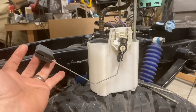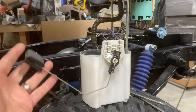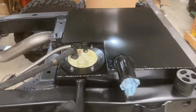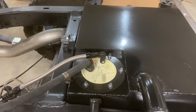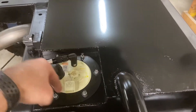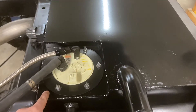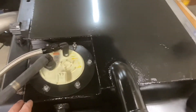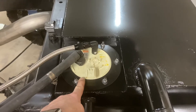This pump isn't included with the tank — these are mods we do for putting it in the tank. The tank just comes without the pump, with an adapter to bolt it down. The production fuel pump module uses a big O-ring — you're probably familiar with the big green O-ring — and we've machined a groove in this quarter-inch metal plate, then put in six studs and a clamp ring. That enables it to seal against the elements and maintain positive pressure inside the tank.